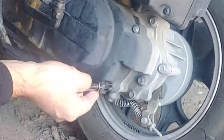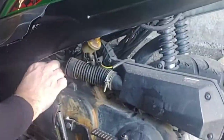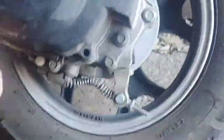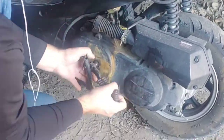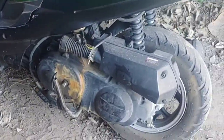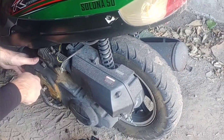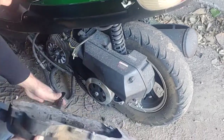We're going to start out by taking the clutch belt cover off here. These are 8mm bolts. They're all the same except for one, and I will point out the one bolt that is different a little bit later in the video. The kickstart doesn't really need to come off, but I took it off anyway because I thought it was in the way of the center stand. It can actually stay on there.